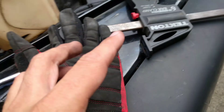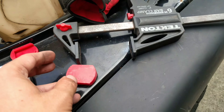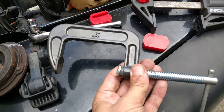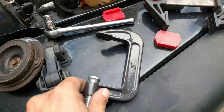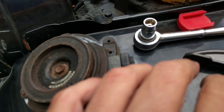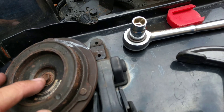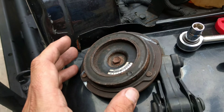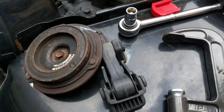There's a spring clip that holds the pulley itself on, so you have to take the bolt off, slide the clutch off, then remove the pin clip, then slide the pulley. The pulley is going to be the hardest part because you can't pry it off — otherwise you'll damage the shaft's integrity to keep it sealed in the compressor. I tried a bar clamp but had to pull the rubber ends off because it kept sliding. It was too big, but luckily I had a 3-inch C-clamp which was the perfect size. I'd recommend getting one of these.